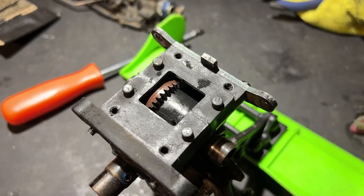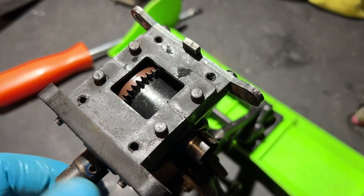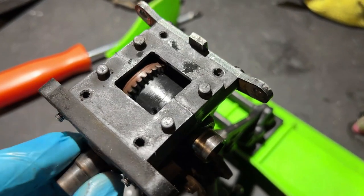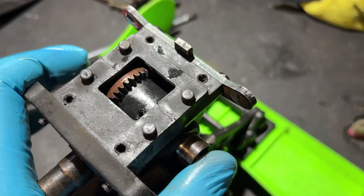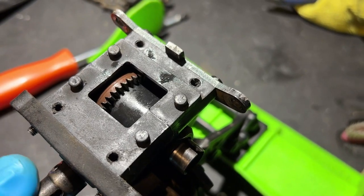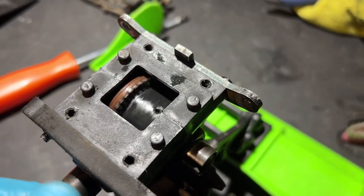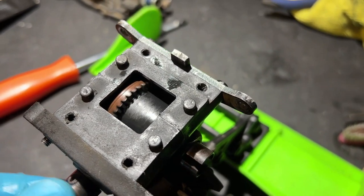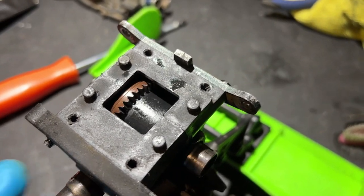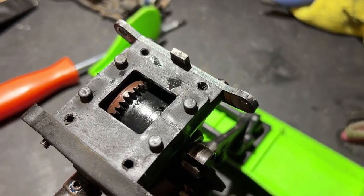I also topped up the diff fluid. Got it all back together for a quick test fit — it's still a tiny bit rough in a couple of spots, but the main thing is there's now no play in or out on this shaft or left to right. There's a tiny little bit of play on the tooth and a couple of rough spots, but I think they should work themselves in and bed in. The right thing to do is just to replace the whole lot, but I think it's going to be fine. We'll have the parts car with us next time we go to the track, so let's get some grease in there and get the whole rear end back together.